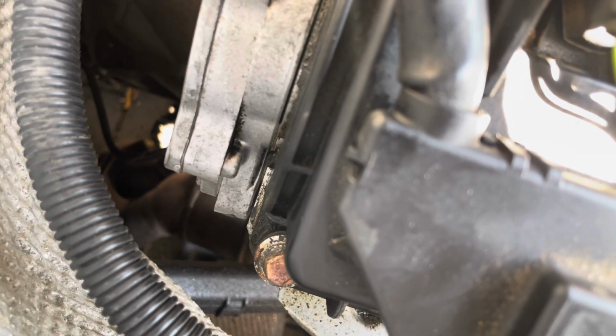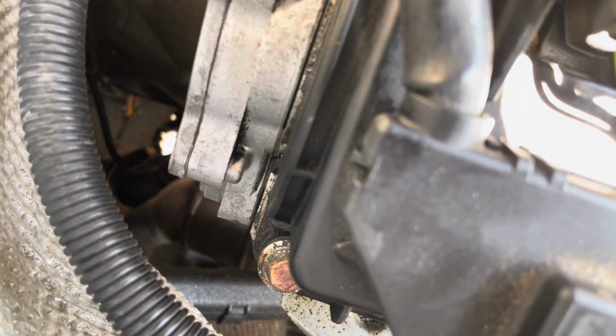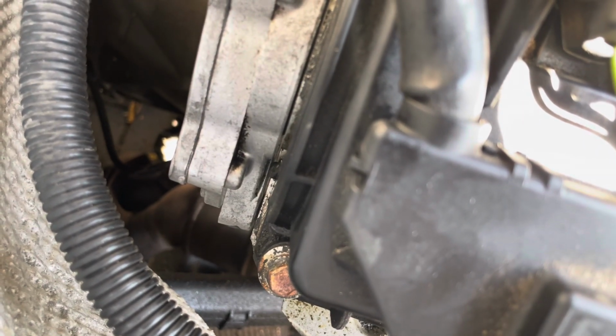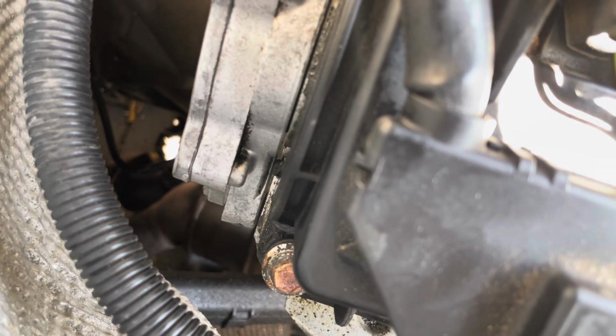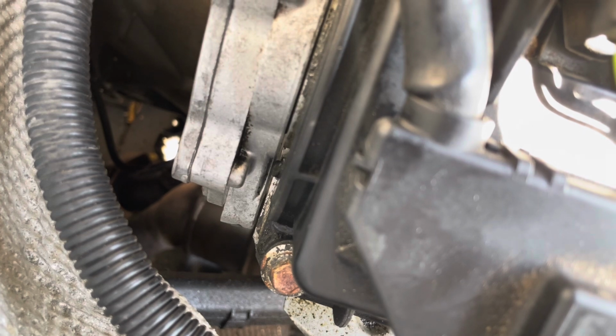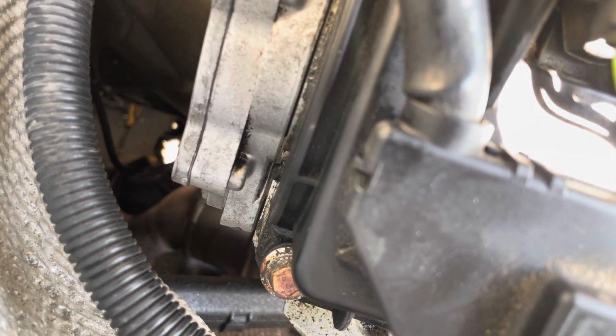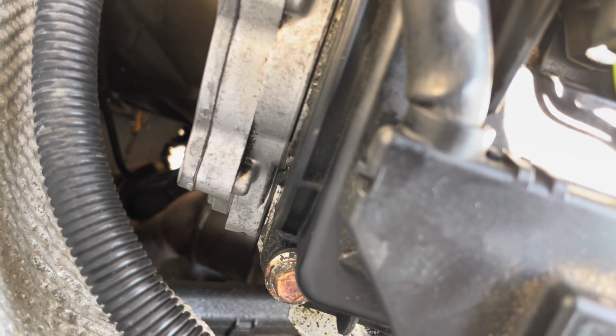But if you look a bit towards the top where the O-ring should be, you can see a little black insert there. Now that definitely seems flush. So what I think is that the reason I can't get this flush is because the O-ring is quite big, and it's not letting me get flush. So I'm assuming that once I tighten up these 10mm bolts, it will look a bit more flush than that.